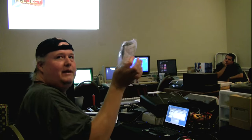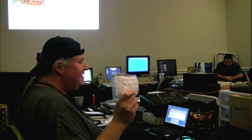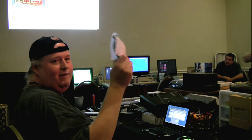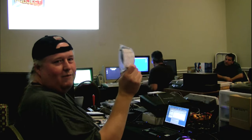I haven't tried it yet, but apparently this is the correct one, because I bought one off of Amazon, and I plugged it in, and it was all wrong. I got buzzing on the audio, and I'm like, no, it's the video signal. I can hear the 60-hertz video signal. I'm like, this isn't right, and I went and looked it up, and I'm like, oh, it's real specific. So if you need to look at it in the AV mode, make sure you get the Zune cable, or one compatible with the Zune player. Worth mentioning, it'll save you some time and money.